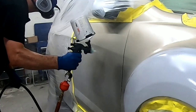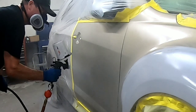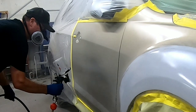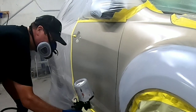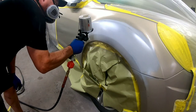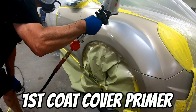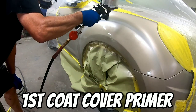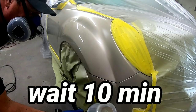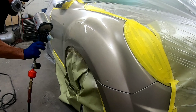Spray your wet bed just like you're spraying paint with the same gun settings. I'm doing 20 psi on the gun, almost a full fan pattern, and three turns out on the volume — you want it to be wet, that's the whole idea. Then when you apply your base coat it has something to melt into. On your first coat of base you want to cover the primer; don't be concerned about the blend just yet. Let it flash for 10 minutes and then put on the second coat until the primer is covered.